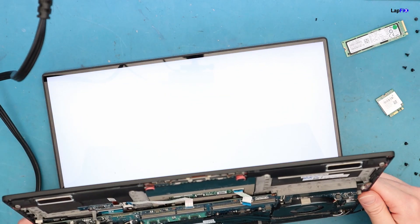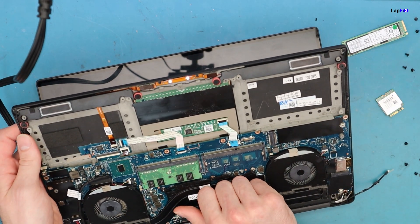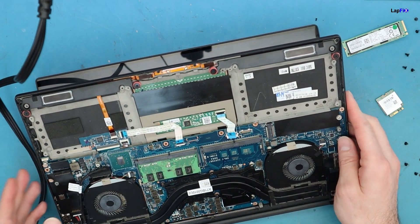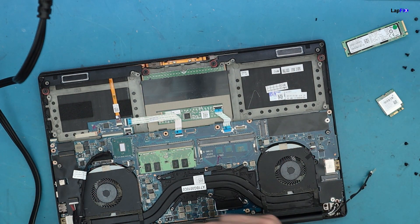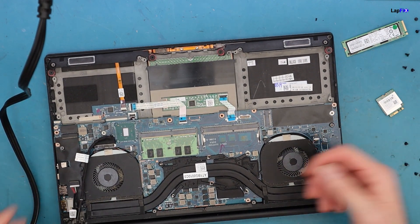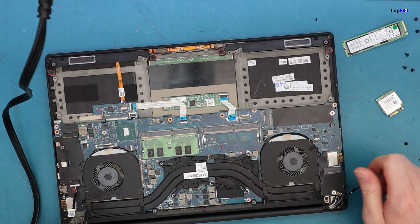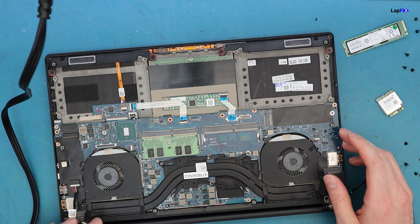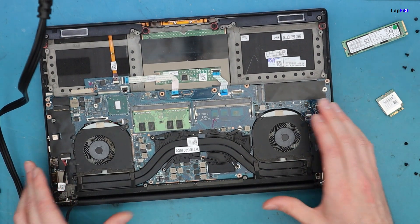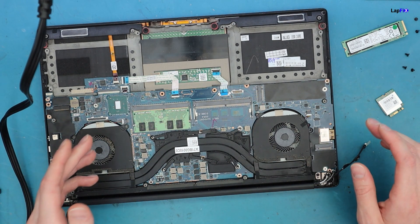So what do we actually see going on? The CPU and GPU are both getting warm. We already tested the RAM — we tried both slots with a replacement stick. We want to eliminate more culprits, so let's disconnect the screen and see if that changes anything. There are no signs of liquid spill, no damage we can currently see on this board.